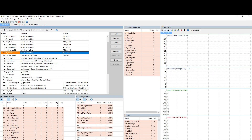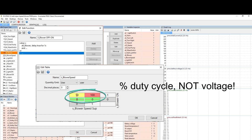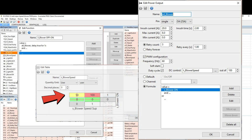The PDU software is used to create all the necessary elements — the switches, the functions, the outputs, and all the other parameters necessary to get the functionality you want. In this case, this is the main button switch. You can see at the bottom the hold time — that's where the long push is defined. A table needed to be created that said when the various switches are in various states, what percentage of the voltage do you want to send over to the motor. Here you can see the 50% or 100%. And then it all comes together and drives an output. I'm using the pulse width modulation functionality and these different functions to control when it's 50%, when it's 100%.